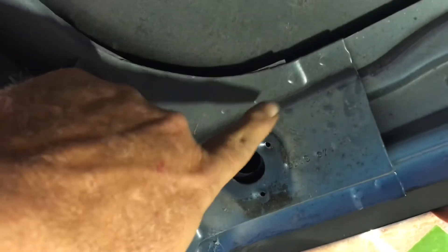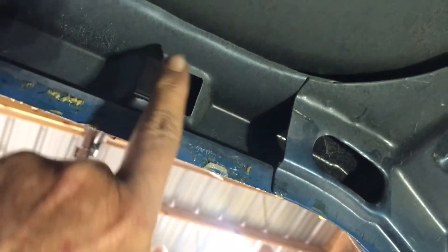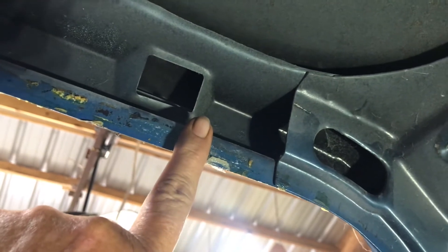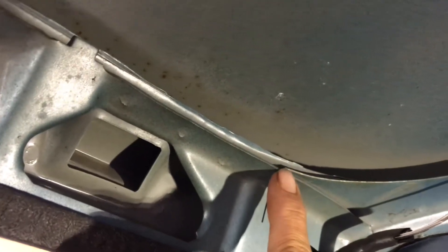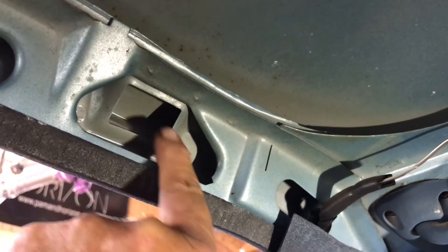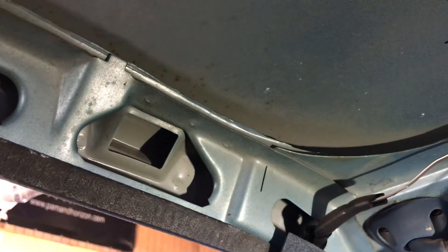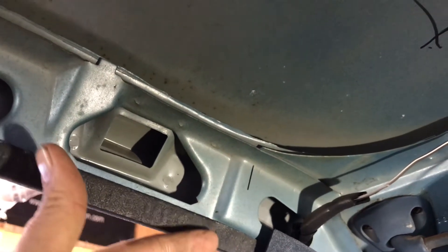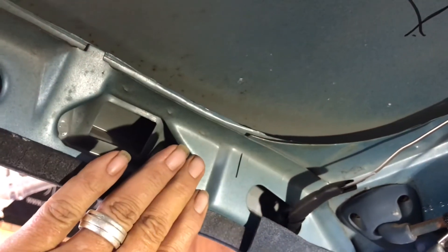So here's one last piece of information. On an 88, this top plate stops right here, then you've got your outer skin and an inside structural support — and it's exactly like the 83 to 85 out front. But on the death trap, which is a 92, that plate still stops at the same point, but they've added another structural plate on top of that. So you've got your outer skin and inner skin just like the other vehicles, but now there's an added plate of stability. I don't know when that happened, but I assume it was around the same time they did the door panels with the NASCAR-style roll bar.